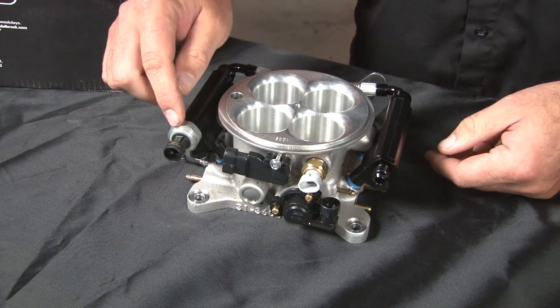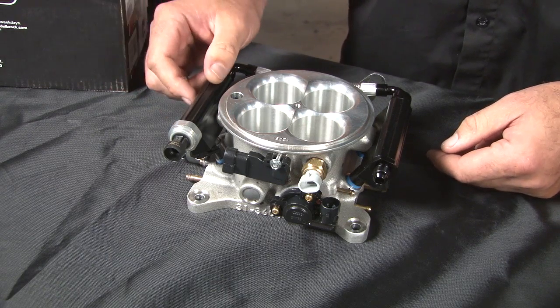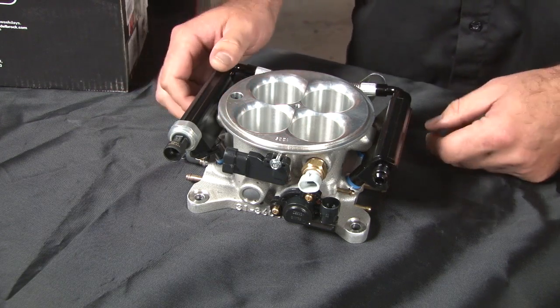The linkage that is actually on the unit itself is the same as what you'll find in your carburetor, so that will make pulling your carburetor off much easier when installing this. All of the sensors come included on the actual throttle body itself. So you have your air intake, your TPS, your map sensor, and this is actually a fuel pressure sensor for the returnless style setup that we offer this kit with. Your fuel will come in, it will come around, it will stop here, and the computer will actually control the amount of fuel pressure necessary for your particular application.